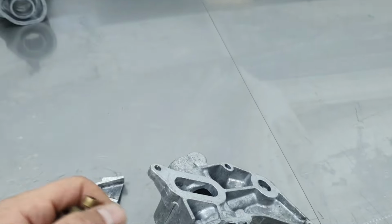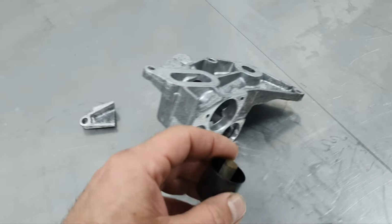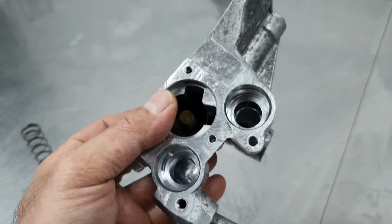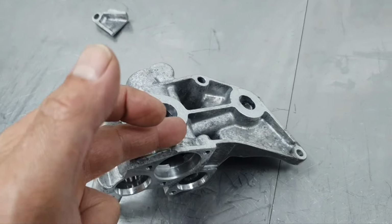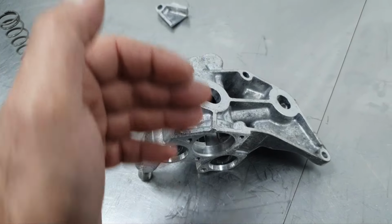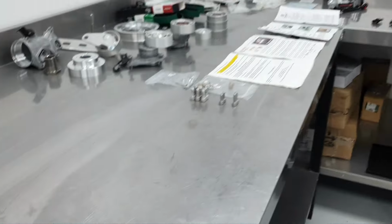You're gonna extract the piston here to open a clear path for the oil cooler. As an example, if to open completely, to block this path, this one here, and open the other path 100%, it needs to reach 120 degrees, you can modify the spring, like what I'm doing all the time, to do that earlier. To not wait to open the path, to close the bypass here and to open the other path at 120 degrees. To make this happen sooner, so you don't have to reach such a high oil temperature. That's the principle with the thermostats, okay? Just a small adjustment. That's it, over and out.